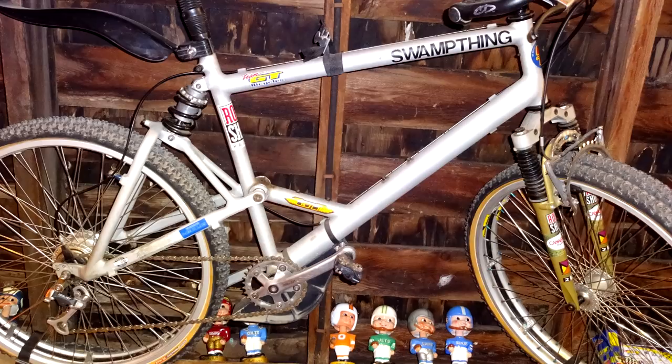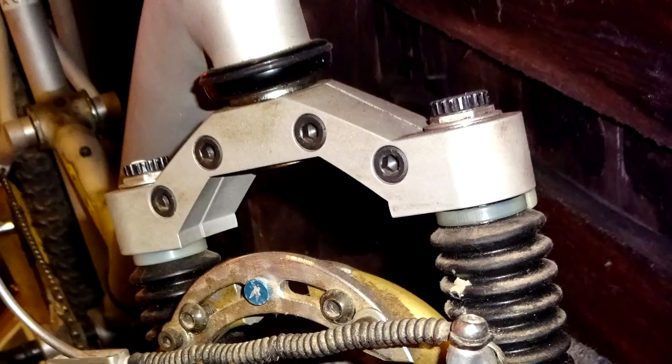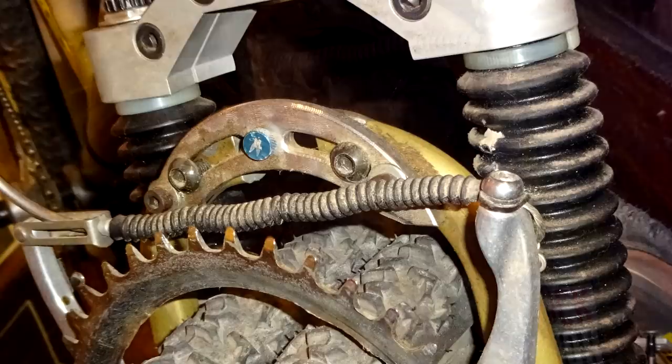Because the wheels were significantly wider, he had to make modifications to the front end. He had RockShox Mag 21 forks, and it looks like he fabricated a whole new fork crown to move the tubes wider. Since the tubes were wider, he had to cut the fork bridge and add a little plate between the two to hold them together and keep them from twisting.